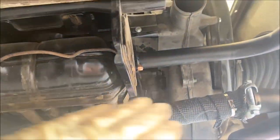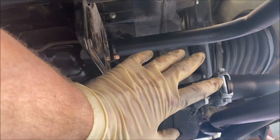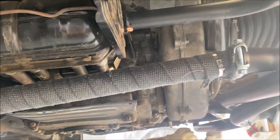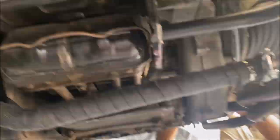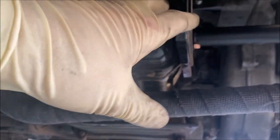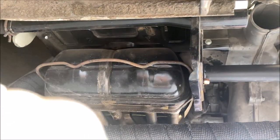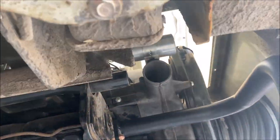We're getting everything buttoned up. I'm not gonna lie, some of the fitment alignment between the J-tubes and the header itself is a little questionable. I've always kind of hated these donut gasket clamp arrangements - maybe I should have sprung for the extra money and bought the bolt-on J-tubes and bolt-on header. Tightening up some of the flanges seemed questionable in a couple of spots, so this might be a case of fire everything up, let it run, let it cool, then re-tighten.